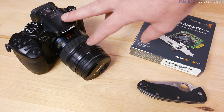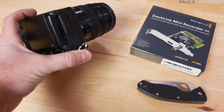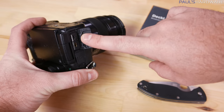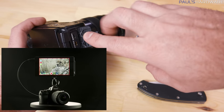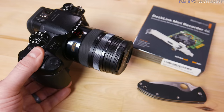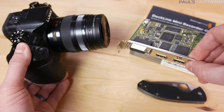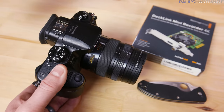There's a very specific reason why I bought this quickly when I spotted it — I have two Panasonic Lumix GH4 cameras. These GH4s have an HDMI out on the side, and it's a unique feature that the camera can actually output 4:2:2 10-bit 4K resolution over HDMI. You can use that with something like an Atomos Shogun, which is an external recorder that lets you record in that really high resolution with great color depth. However, the existing Blackmagic Intensity Pro 4K will not accept the 4K signal from the GH4 — unless you use outdated firmware.